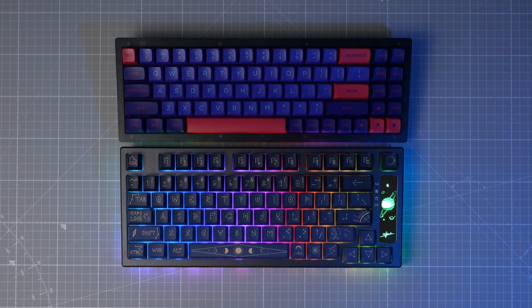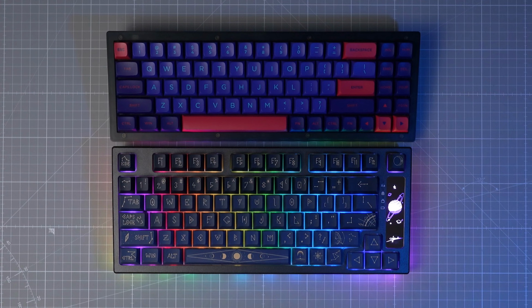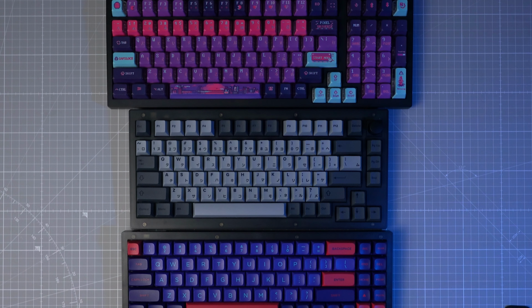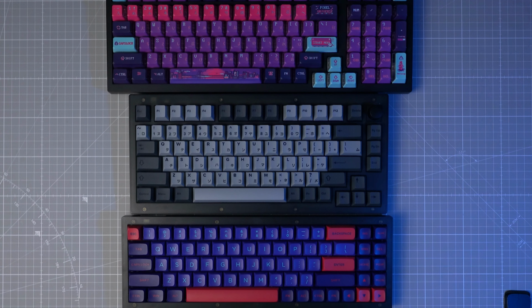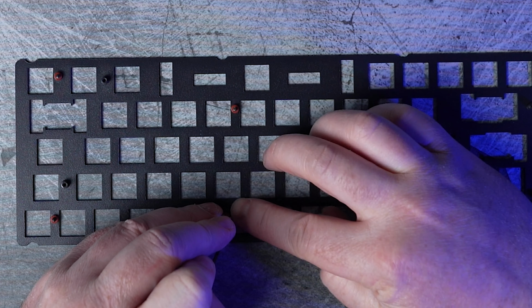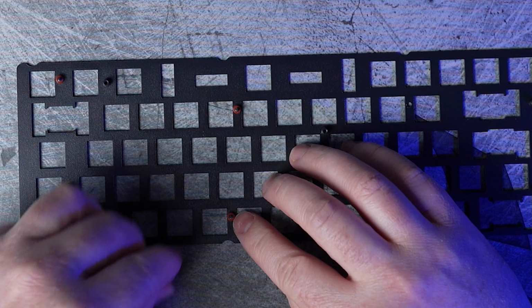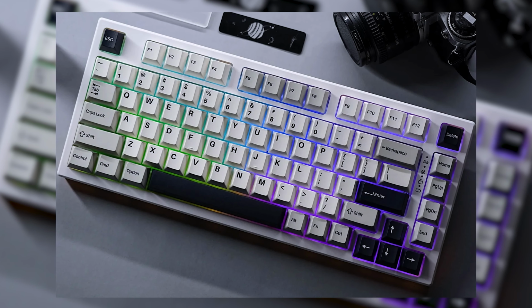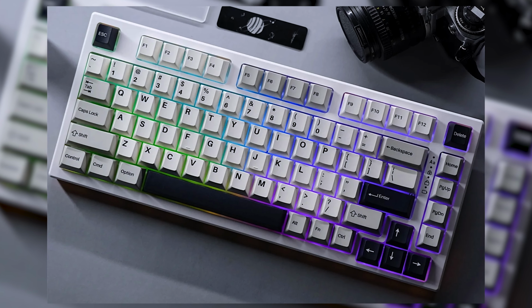In my opinion, the Keychron V series keyboards end up nicer in terms of the typing sound and feel, mainly because of the case and plate material quality and the consistency given by the tray mount. You can apply the same mods to the V series as I did on this one, but you can also do the O-ring mod if you want to, which results in a nicer sound and feel. However, the aesthetic of this keyboard is different and will be preferred by some.